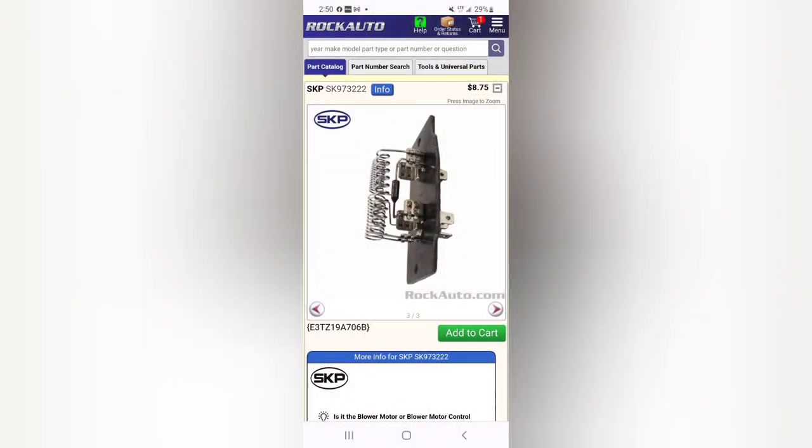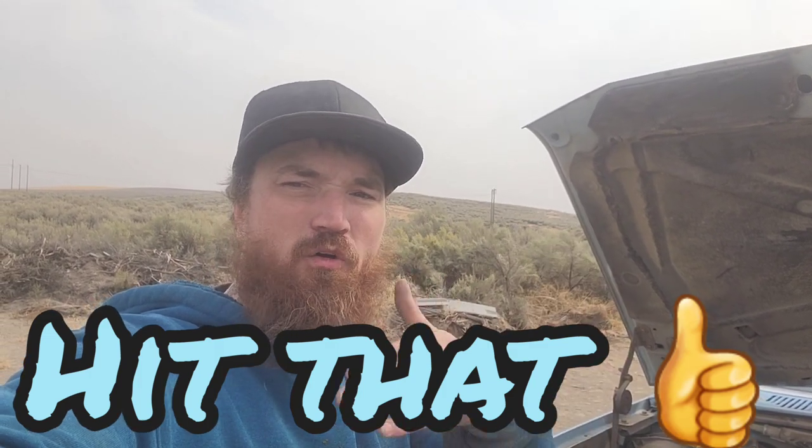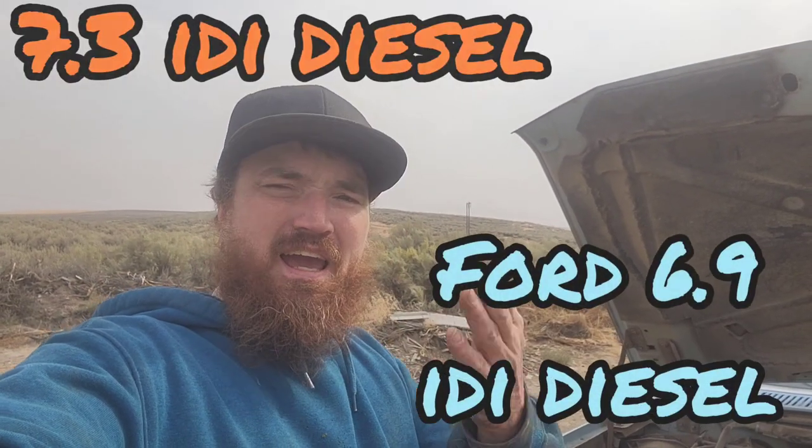The new resistor part is only about nine bucks so I'll definitely be ordering it to install in the future. Unfortunately guys, this isn't going to be a complete repair video this weekend - I've got an order in for the parts but they're not going to be here until the middle of the week. I appreciate you watching - I hope I taught you a few things about how to diagnose, how to trace a problem, how to mentally figure it out with your test light: see where there's power, where there's not, and trace it back. Hit that subscribe button if you want to see future content of me fixing my IDI diesel trucks. Check out the video description for more videos about these old IDIs. Until next time - believe in what God gave you, take on some projects, build, fix, create, keep building.